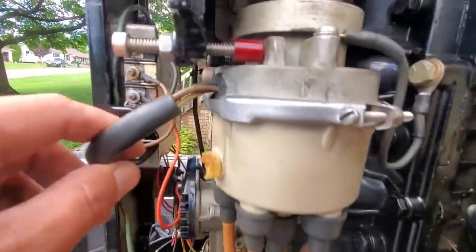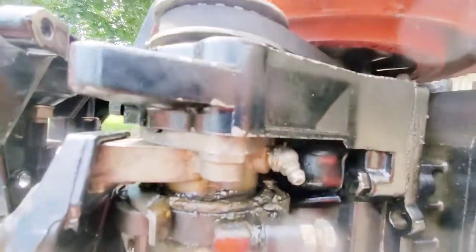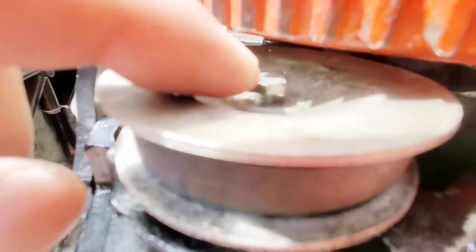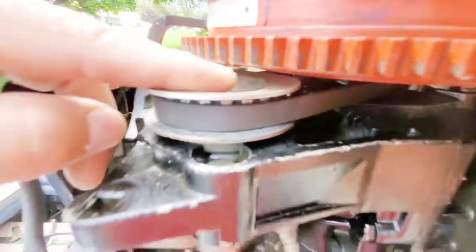Unfortunately, even though it looks good, it talks the talk but it does not walk the walk. Now that A-Ron and I have the top cowling off, this one does not have the 11 metric on the bottom, so we're going to have to move the cowling on the top — that's going to be an 8 metric. Be very careful, that's the smallest screw on this engine. You definitely don't want to snap it in there, because that's a whole other problem you don't want to deal with.